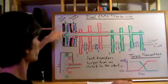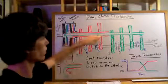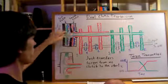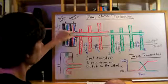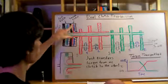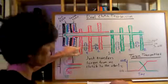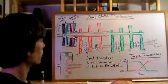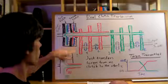So your torque was initially going down this green shaft to the first gear and then to the output shaft. Well, the clutches switch which one's engaged, and so then it'll go from second. So instantaneously it's going from this green to the red shaft and then to second gear to the output shaft to the differential. So, alright, let's just go ahead to the next gear.